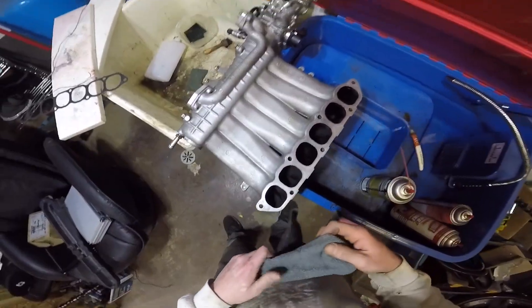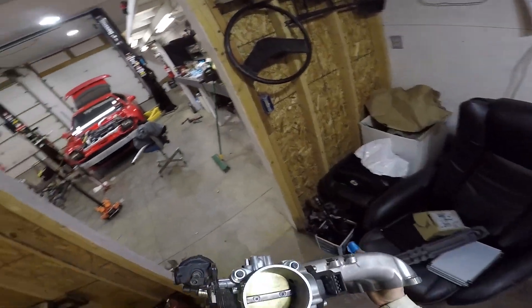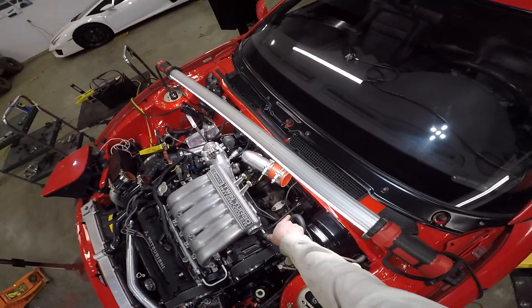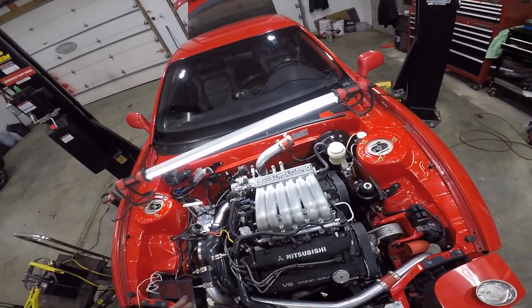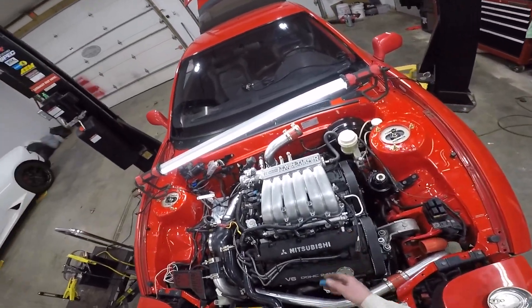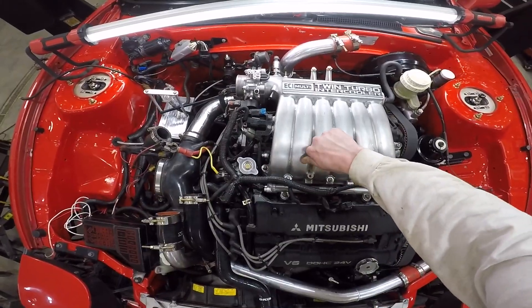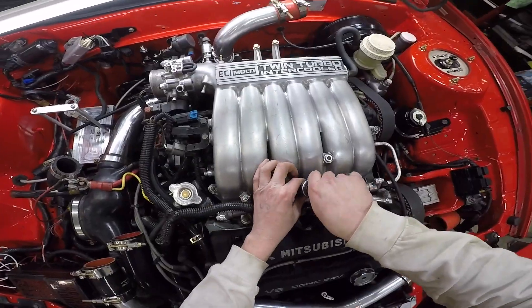Let me clean this up real quick to get a nice good mating surface. I definitely shouldn't have started this — now I'm gonna clean up the whole inside of this thing. This is as good as I'm gonna get; I'll be here all day trying to clean the whole inside. Gotta have one with a check valve on here so this doesn't get boosted. I gotta put the coolant lines on. This is 13 with bolts — I don't know what the studs are, so I'm gonna go with 13 for now. I'd rather be safe and have a little leak and tighten it up than warp this thing.